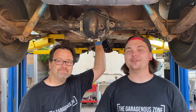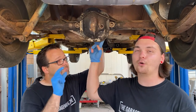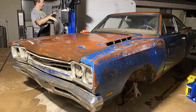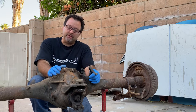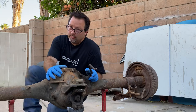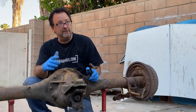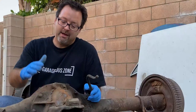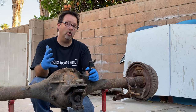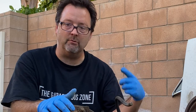So if you've been following our series, you know that this thing is a performance monster, which means that we need to swap out this 7 1/4 itty bitty rear end for an 8 3/4 out of my 1969 Roadrunner. The reason we're putting in the 8 3/4 rear end is not that we think it's going to break from all 43 horsepower, but that this one has a better gear ratio and is a 3.23 Sure Grip rear end — a limited slip — where the one in the car is just an open one. It's the one-wheel peel; only one tire turns. Hopefully this will give us a lot better performance.